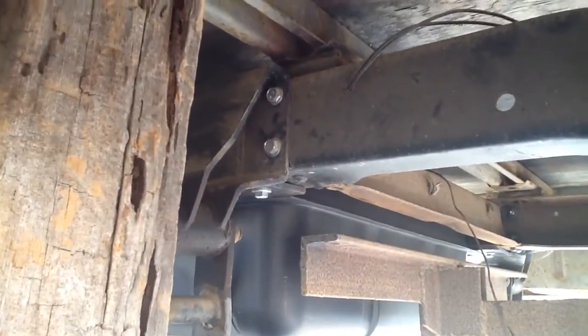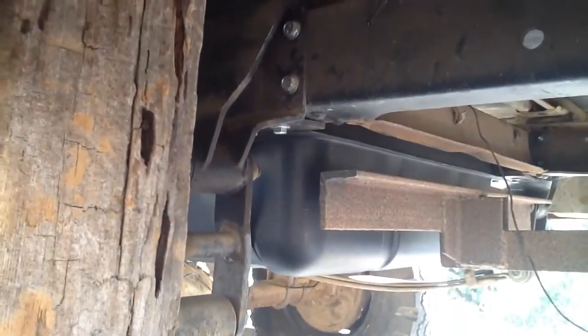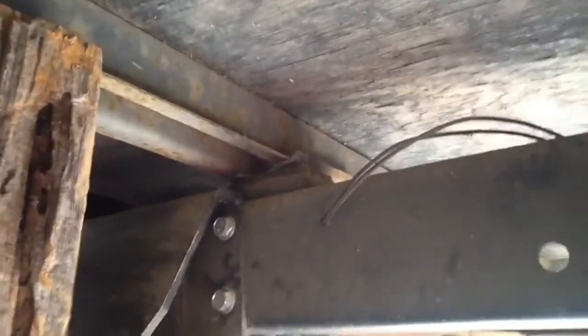Position 5 is right above the shackle — you can see I have the DIY 4x shackle flip there. I'm going to go across this beam with a sturdy block of wood. The 6th position is all the way in the back. Both of these bolts snapped, so I got all new hardware. I'm going to take these out and clean it up a bit because there's some rust, and attack where the mounts are since it's a 4x4 and a lot of mud gets stuck there.